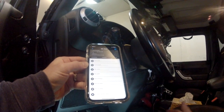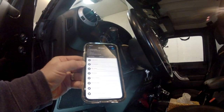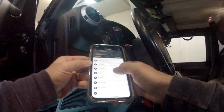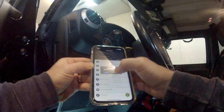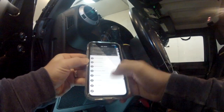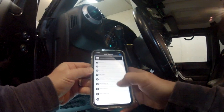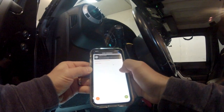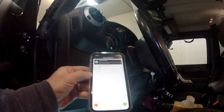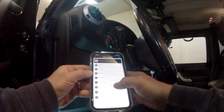I'm going to be using this application to adjust the gear ratio when I regear my one-tons going into the Jeep — that's going to be super handy. There's also an option to change the tire pressure monitoring system threshold. For those of you who run larger tires on narrow rims and want to change the threshold, you can do that here. I have mine set to 26 PSI right now, so my tire pressure indication doesn't come on until 26 PSI.